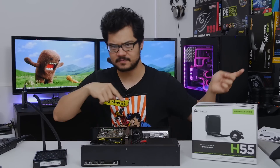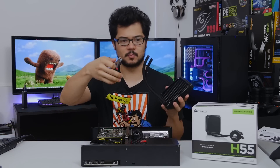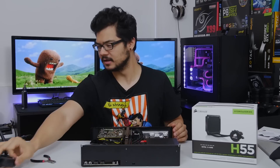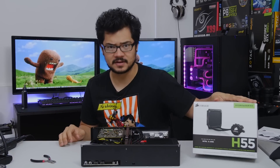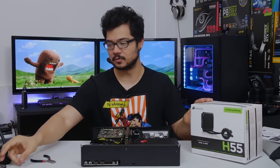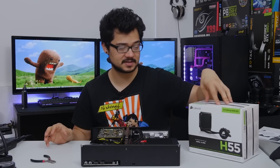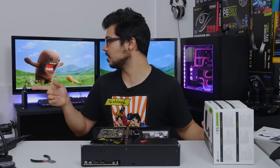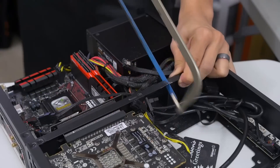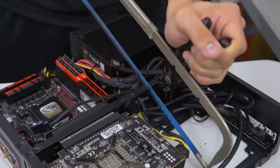This is 24 hours later after the last clip you saw. After realizing there was no way to recover this pump or fix it, I pretty much just snipped the tubing clean with wire cutters — it's never going to work again anyway. I also bought a Corsair H55 liquid cooler — another 120mm radiator that's pretty much the exact same OEM dimensions as the Zalman. It even has the same mounting bracket for the water block, so I wanted to keep things consistent. I'll be ditching the stock Corsair fan since it's apparently pretty noisy, and using the Cooler Master from the Neptune 120 XL instead. I've also already made the incision into the metal crossbar of the case to allow the tubing to pass through, so I don't have to disconnect the water block and risk not being able to refill it again.